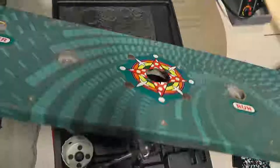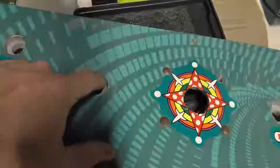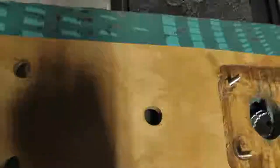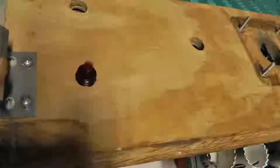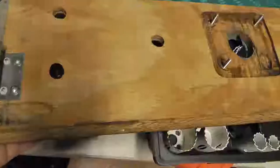This came out of a Defender — or actually Wild Ride — control panel. The operator cut this himself; this isn't a standard Defender control panel as far as I can tell, otherwise the buttons would be totally different. But he actually did a good job so he could do a direct-to-wood leaf switch mount. You can see the hole is bigger up top — about one and an eighth inch — and then on the bottom it's smaller, so when you put a button in, just the smaller part pokes through, holding the button in place. You put a lock nut on it and mount a leaf switch directly to the wood.